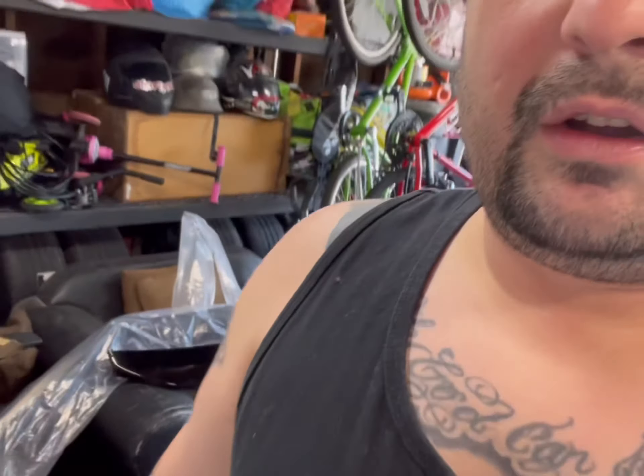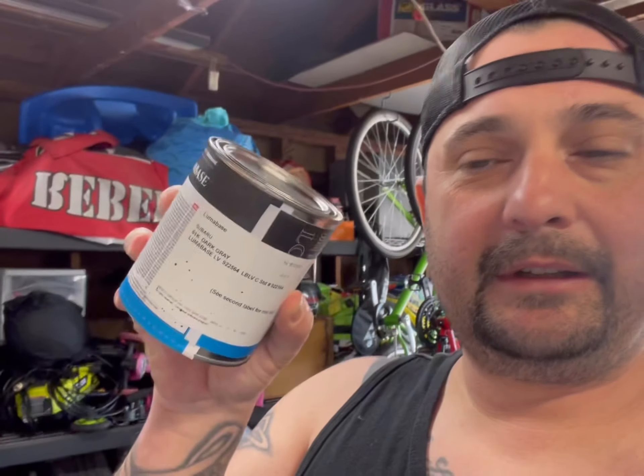I had to go to my automotive paint store — I got this which is the same color as my car, they mixed it up and put some in a spray can because I didn't want to use a paint gun. This is going to be a video for DIYers that don't have a compressor or spray gun, who want to see if they like painting without spending all that money first. This is literally 2K clear — the best stuff you can get. It's two parts with an activator, just like the clear they use in body shops but without the gun.